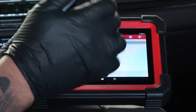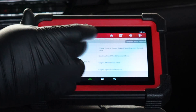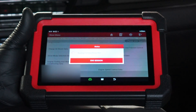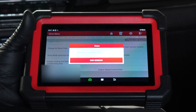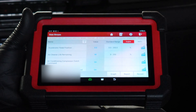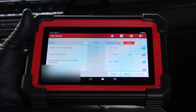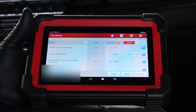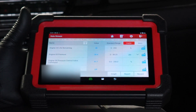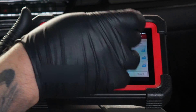Let's check out some data — read data stream. We could do charge air boost data, but let's go to engine mechanical data because I want to see oil pressure. On the dash it looks like it's reading around three PSI and people freak out, but we can actually get a real reading from this while idling at temperature. Engine oil pressure: 19.8 PSI. Give it a rev — that jumped up to 34, 33. So it's sitting at like five PSI on the dash, but it's really around 20 at temperature. Engine oil pressure control valve command changes when we rev it — so it's modulating it.